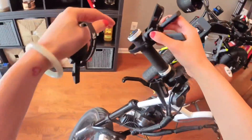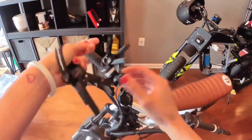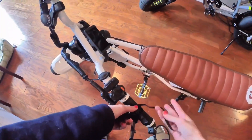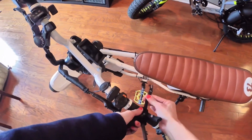We'll start by attaching our Handlebar Jacks to the handlebars. We'll use the velcro strap to fasten them on tight. Once we get both jacks onto the handlebars, we can adjust them as needed. We'll want to make sure that they're fastened as tight as can be so that when we flip the bike over it can support the full weight of the bike.